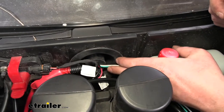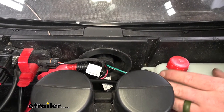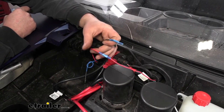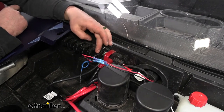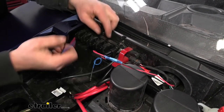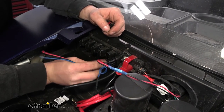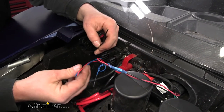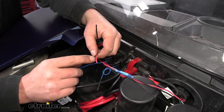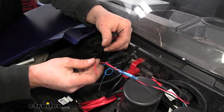Here's where I run the wires. Polaris actually gave us a really convenient grommet that's already right there — I just pushed the wires right through and they shot underneath the dash. We are also going to have to run a power and ground wire through there. Polaris offers these plugs that we can use right from the factory. You simply pull the caps out, take your plug, and plug it in — that's going to give us the power and ground we need. The black wire will be ground, the red wire will be a constant 12 volts regardless of whether your key is on or not, and the blue wire is key-on power. I'm not going to worry about the blue one — you just want to use the red and the black.